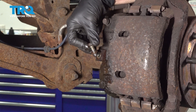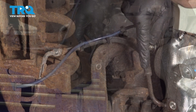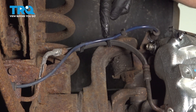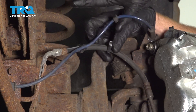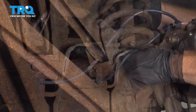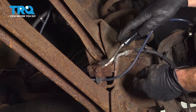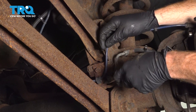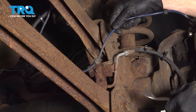There's our banjo bolt, one of our crushed gaskets, and the other one just fell out of place. Let's continue following the flex hose. You'll find that the ABS wire is clipped onto it. We'll disconnect that ABS wire by gently tugging it away from the flex hose. Now that we have those two broken free, you'll find that it goes right into the bracket here. To remove this, you can use a trim tool or a small prying device to get in between this area and separate it from the bracket.